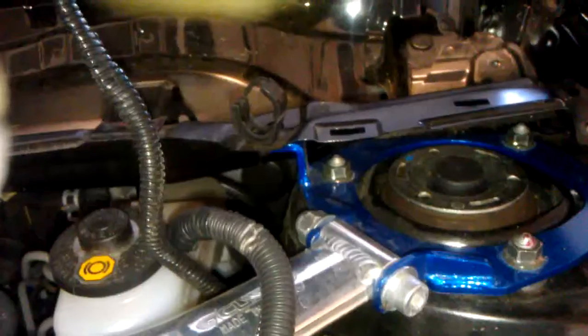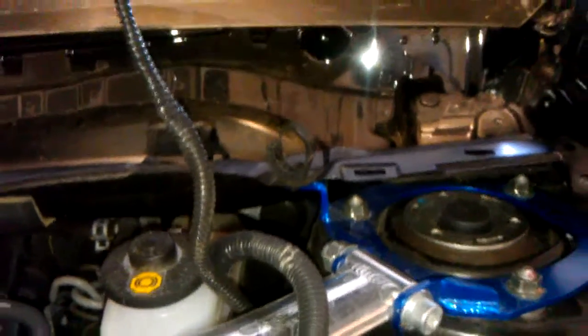There's a clip holding a wire for the windshield wiper motor, so you've got to remove that clip, open it up, and get the wire out. I removed the power wire. Now we just lift up the cowl and slide it out. That's the metal cowl.